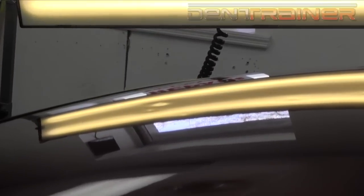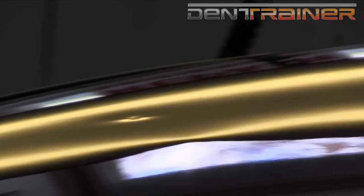We're going to start with the front of the roof and work my way through the damage. I'm going to make strategic pushes on the center of these dents. A lot of times I look at every one of these dents and think I'm going to knock this out to about an 80 to 95 percent level. I'm going to keep moving because we're going to come through and we're going to have to cross-check all of this work.